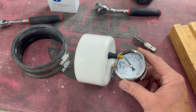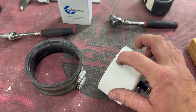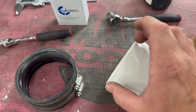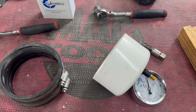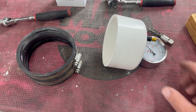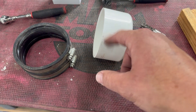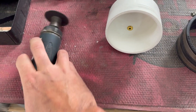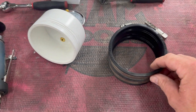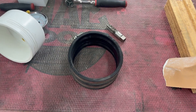Now that we've got the assembly all together, one thing to note is that we're probably going to want to scuff up this cap with some sandpaper. I'm going to take my grinder wheel and just make a lip, because inside this boot you can see there's a couple of grooves — something to help bite onto it. I'll take some 120-grit sandpaper and just scuff the end of it, put a little line in there with the grinder to kind of help hold it on. You're not going to be able to pump it up to a hundred pounds without it pushing the coupler out, but just something to help keep it in there. I'm going to try to get it somewhere around 10 to 15 pounds. I doubt I'll be able to get it up to 20 PSI, but you should know if you have a leak by then. I just took my cutoff wheel, made a couple little lines on it — nothing too scientific — scratched it down with some 180-grit, then took a little brake cleaner and sprayed out the inside of the coupler to make sure there isn't a lot of grease in it.